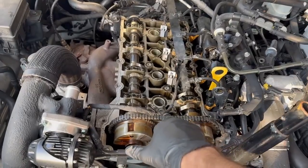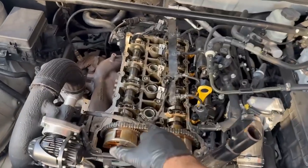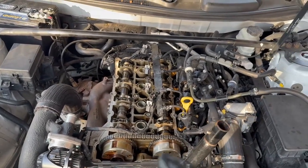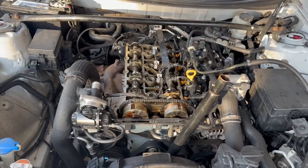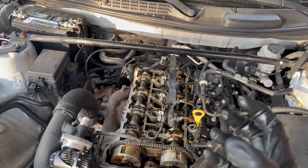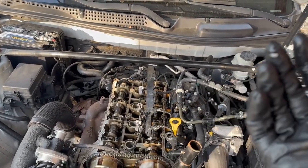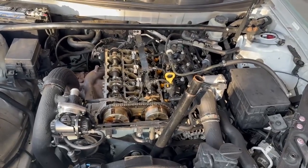Also, I know you can't really tell if it's timing chain slap, but there is excessive play in it, though it's not super loose. Obviously taking off the front cover would give me a better idea, but I've also jerked the crank back and forth, and I don't hear any slapping on the bottom end, so it sounds like the bottom bearings are okay. At least there isn't super excessive slap.